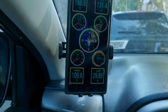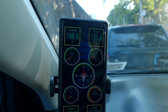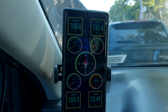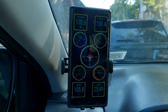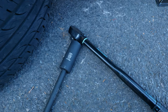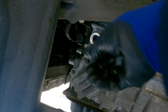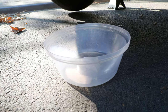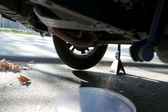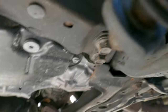The transmission temperature is actually higher than what's required — it's at 131. I'm going to have to let it sit for a bit to cool down to around 114. Using a 24mm socket, I'm going to remove the fill plug. Now we have a drain pan at the bottom.